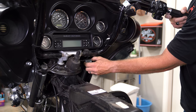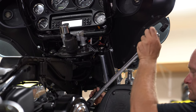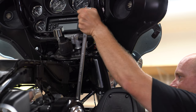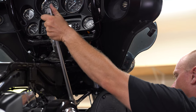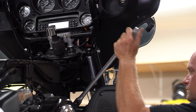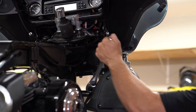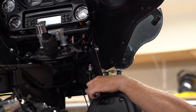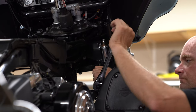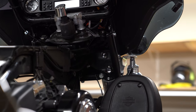We've already got the fork cap nut off. Now he's going to go ahead with his 5/8 inch socket — there's the lower fork clamp bolt — and he's going to loosen that. We just want to drop the fork down just a little ways. The reason we want to drop it just a little and tighten it back up is to get some clearance so we can take our fork cap bolt off — we're using the bike to get some leverage on it. You can see he's dropped it down just a little bit so we can access that fork cap bolt. Now he's just tightening his pinch bolt to hold it in there securely while he gets leverage. With a 21 millimeter open end wrench he can get leverage on that fork cap bolt and he got it broke loose. Now he's going to loosen that lower pinch bolt — with his other hand he's holding onto the front of the fork because it'll just slide right out. You can see he's sliding it out.